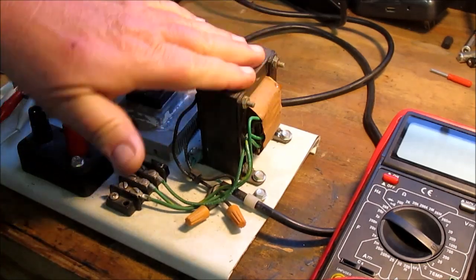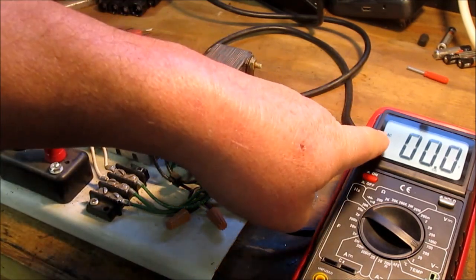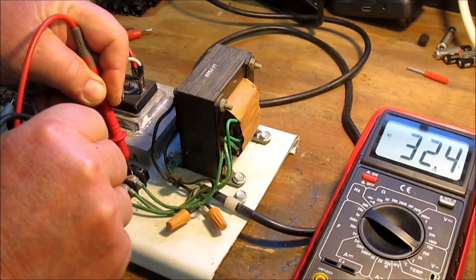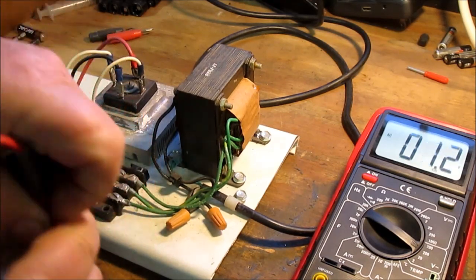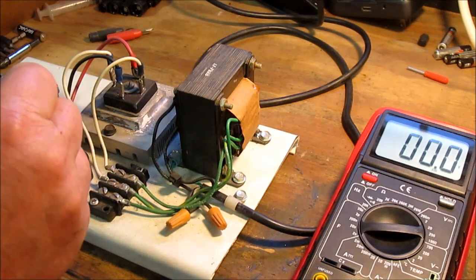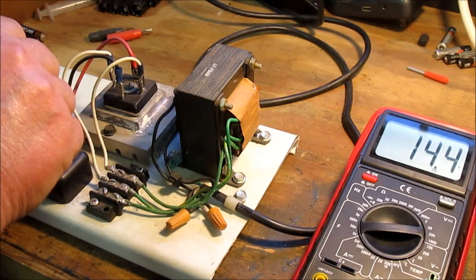To verify my setup, I've got it powered up. We'll turn on the multimeter. I've got it set to AC. Going across the outside terminals, it's showing about 32 volts AC. Now going from the center terminal over, I've got 16 volts AC. Now we're going to flip the meter to DC, and coming off the bridge rectifier I've got 14.4 volts DC — very good for testing lawnmower components. So now we'll go in and see what the regulator is doing.